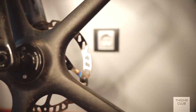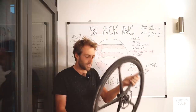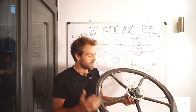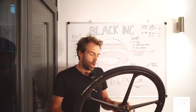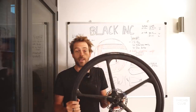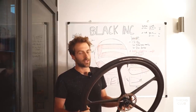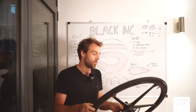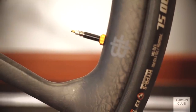These are a solid-spoke, handcrafted, specifically designed one-piece rim and spoke blade construction, and they really are Black Inc taking a no-holds-barred approach to the wheel. Mostly manufacturers have to work within the constraints of UCI rules, whereas these are not - this is a wheel to go out and enjoy riding your bike. They're tubeless ready, a clincher - I don't believe they come in a tubular option. A complete set weighs in at 1,118 grams. That's marginally heavier than a lightweight Lightweight Meilensteiner wheelset, but bearing in mind these are disc brake and tubeless ready, which notoriously adds weight, they're actually coming in pretty light - and they're aero.